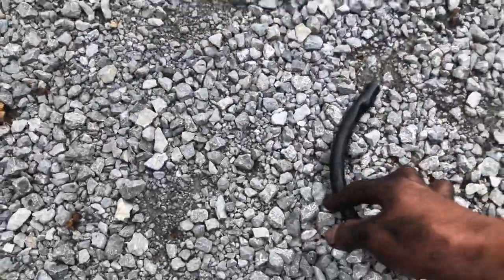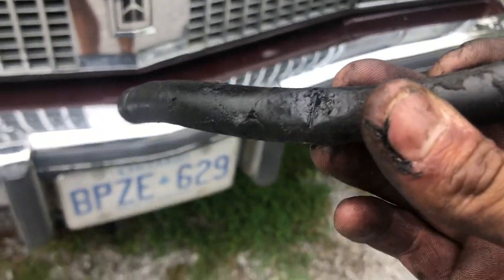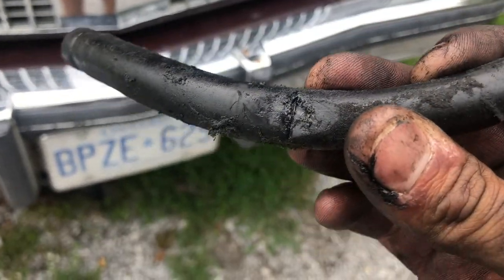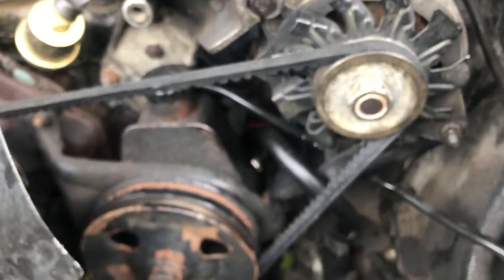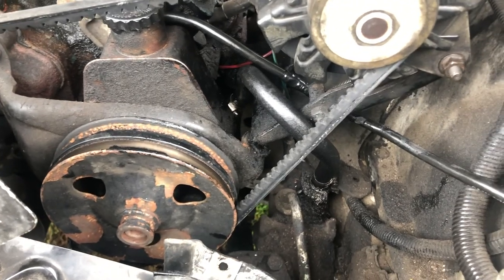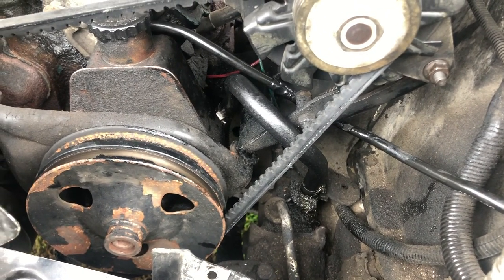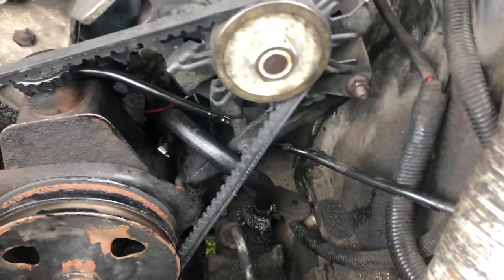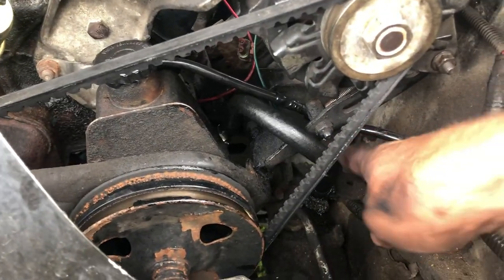The problem is there's nothing really wrong with this hose. The problem is where the hose is located. As we can tell here, the hose has been rubbing up against the alternator bracket assembly, and it was routed right in the middle of it. But because we're dealing with a 1979 engine in a 1990 body, we just really have nowhere to route it.